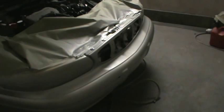So yeah, that's where we're at. One quick silver bumper job. I like that 1K sealer, it's just phenomenal. It's cheap, spray it on, dump it back in the gallon can if you got some left over, and it seems to cover up some real scuffs. I don't think that's something that I can sell to anybody, being that it's not 2K. Unless you want that kind of thing.